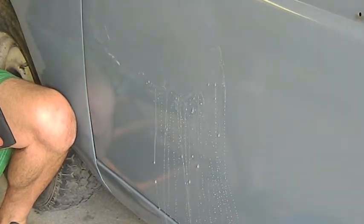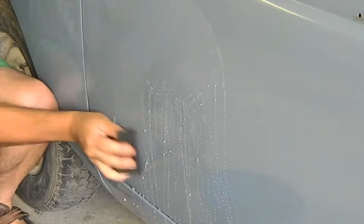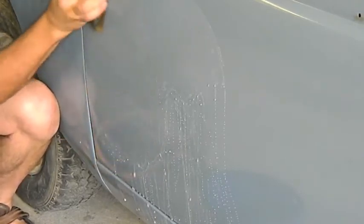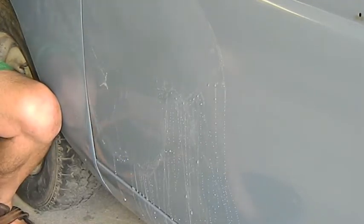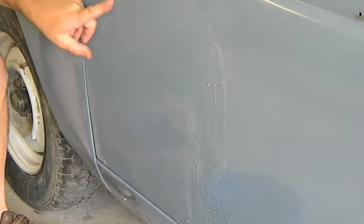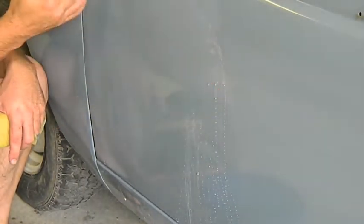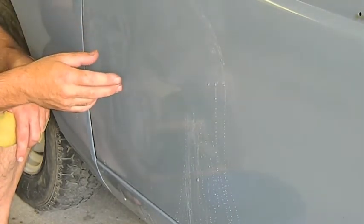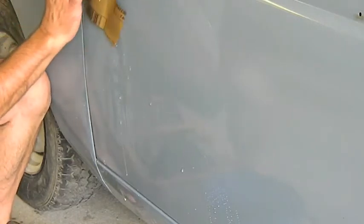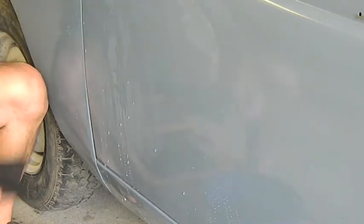That top part there hasn't been cleared, and that's alright — I'm going reasonably gently. It's starting to bite in now, which means I'm taking the tops off the orange peel. If you wipe it down it should look nice and flat. But when you start doing it you'll have taken the tops off and be able to see the bottoms of the valleys of each bit of orange peel. You can't leave it there — if you buff it, it'll look like it's full of humidity blisters. So you need to get it dead uniform, dead low. In the corners you can just work it in without a pad, but don't spend too much time in the corners or you'll destroy all your work.